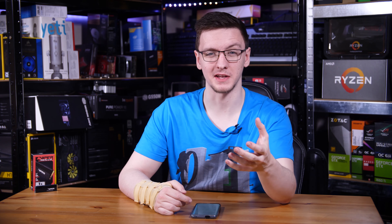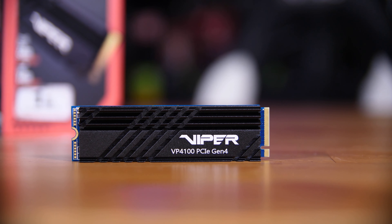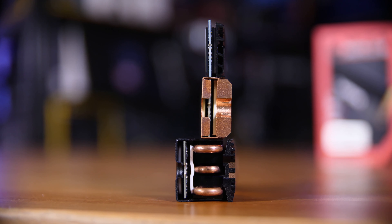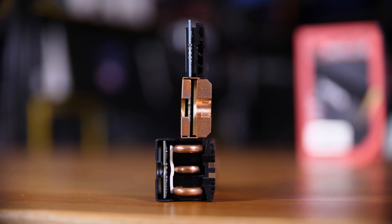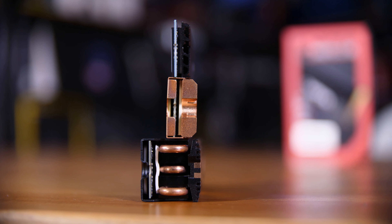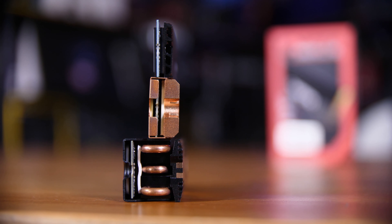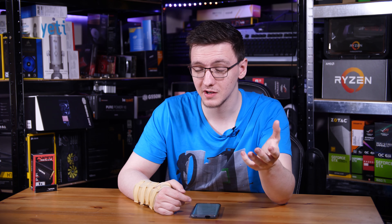It's also not from better cooling. The included heatsink that comes pre-glued to the drive is absolutely minuscule by comparison. Have a look at the thicknesses of these drives, especially the comparison between the VP4100 and the Sabrent one — you could probably fit about five VP4100s in the same space the Sabrent one occupies. But does that mean it runs hotter? Very impressively, no.